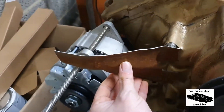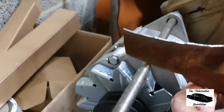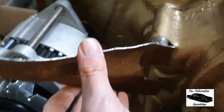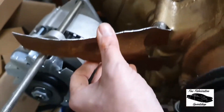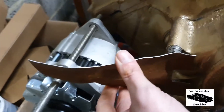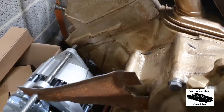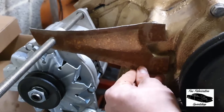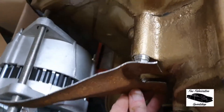As you can see, we've got the shape very roughly modeled in there. In order to work out fully where these are going to lie on this side, I've marked out where I'm going to drill a hole to get this to sit over this rod — which is obviously way too long at the moment. That will enable me to mark out where the holes for here are going to go. I think we're looking roughly okay — we're going to clear all the belts and not have anything causing sharp edges. Based on the assumption you've all drilled holes before, I haven't bothered showing the drilling, but there we go — we've got that mounted on the front there and it sits right where it needs to sit against the water pump.